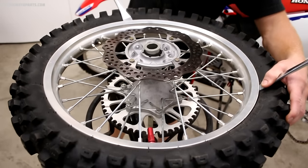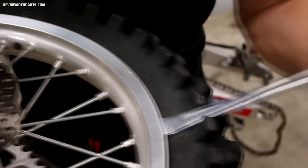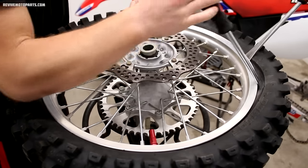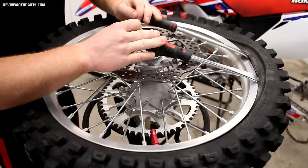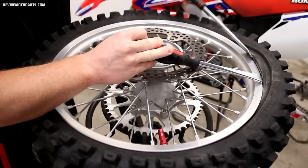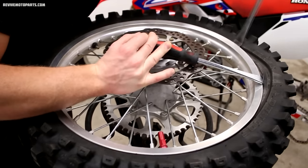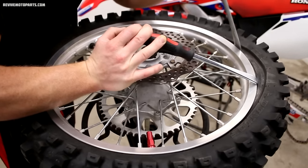With the rotor facing up, it lessens the chance of it being bent. To start working the tire off the rim, insert two tire levers a few inches apart with the spoon facing down. Push each lever in until you feel it hook on the bead of the tire, then work one lever over and then the next. To remove a lever, ease up on the pressure a little bit and wiggle it out. Take about two-inch bites each time — any more than that and you'll be struggling.